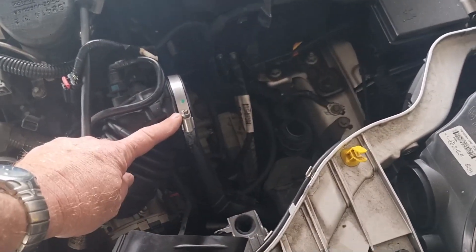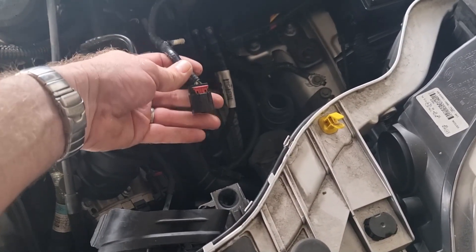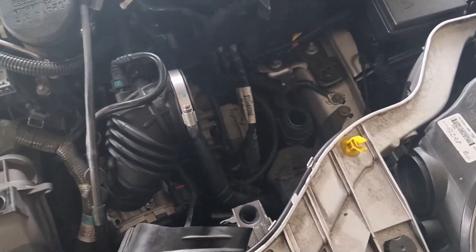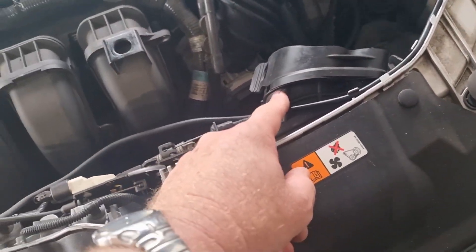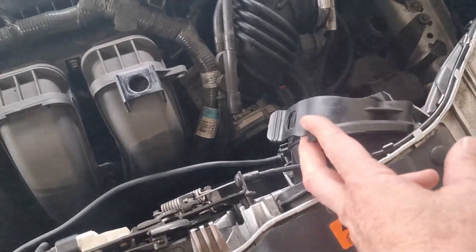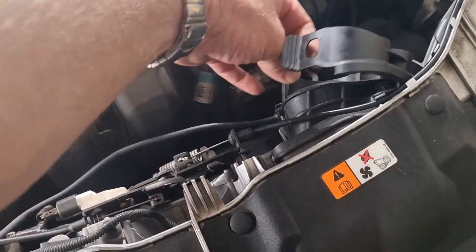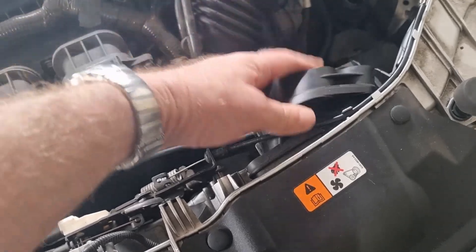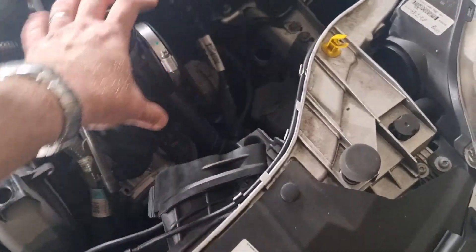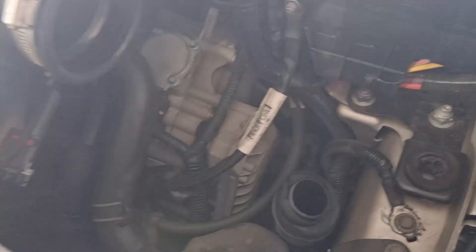For the airbox it's literally this clamp and then there's a plug on the MAF — mass airflow sensor — and a little Christmas tree that pulls out of it. Set that aside and then at this end the air intake, there's just a neat little rubber clasp and a strap so that comes away. The airbox intake also comes off that part. Undo that, undo a plug, and the airbox just comes out — manoeuvre things around and that leaves access.